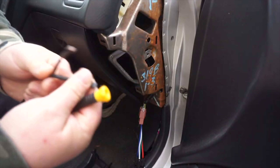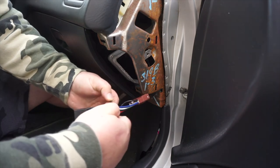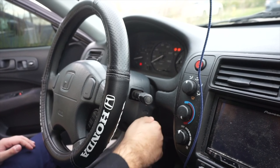Now it's time to install the kill switch portion. Disconnect the two black wires you connected before in the main relay. Now connect in the kill switch, which has simple spade connectors that can only be connected one way. Now it's time to verify that the kill switch works.